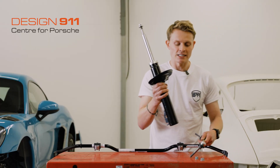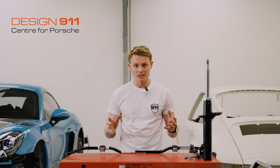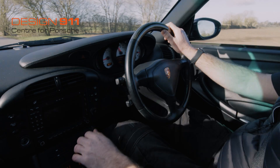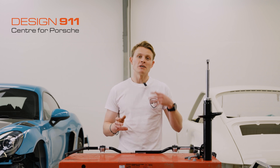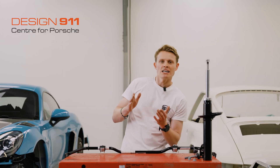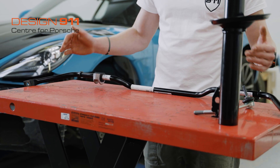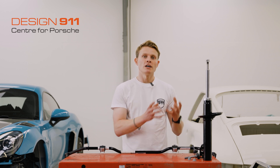So that's how an anti-roll bar is connected to your car. As mentioned, it's a key part of your Porsche's suspension. It's not an essential part so if it does wear it isn't the end of the world, but there will be some telltale signs. The primary one is experiencing a lot more roll when driving. If your anti-roll bar isn't working as designed it will no longer resist that roll when cornering. If your car seems to lean to the outside of a corner a lot more than it used to, there's a good chance the bar itself is fractured or the joints connecting it to the suspension are no longer working correctly.